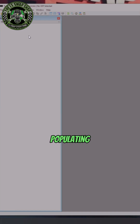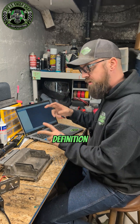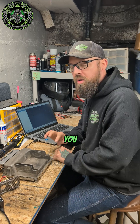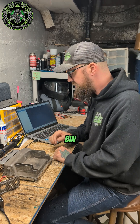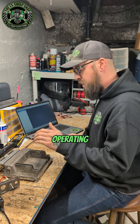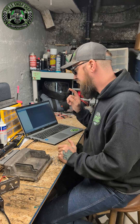There's nothing populating the left side of the screen because you don't have an XDF file. The XDF file is a definition file — it defines all the parameters so that you can modify them. To get an XDF file, you can create a free account on the Gearhead EFI forum and find them in there. You can find bin files and XDF files that people have posted. You need to match the operating system on your bin file with the XDF file you download.